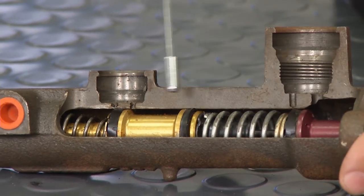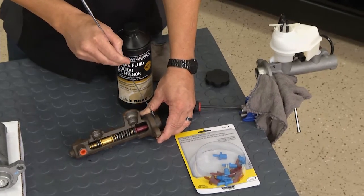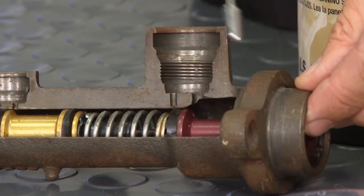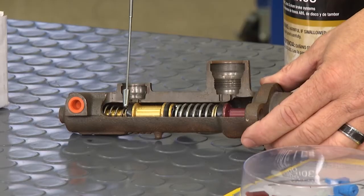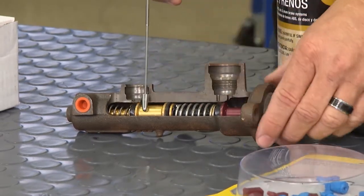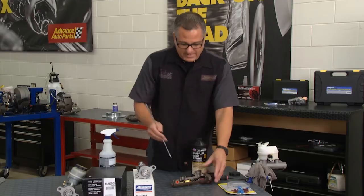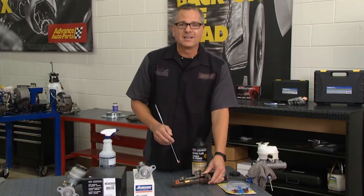You also have secondary seals — the secondary seal for the secondary piston, and the secondary seal for the primary piston is located in the back. If you ever have brake fluid leaking down your booster, it's usually that secondary seal on the primary piston. Now our Impala — the brakes were going to the floor, slowly dropping. These primary pistons were bleeding by internally. The internal pressure was going from the high-pressure chamber over the lip seal into the low-pressure chamber, causing the pedal to slowly drop. Brian is over there installing the master cylinder and I'm pretty sure this is going to fix our Impala.